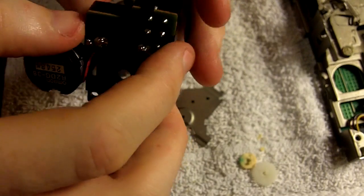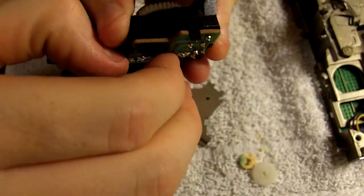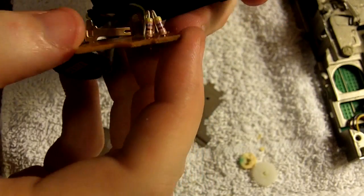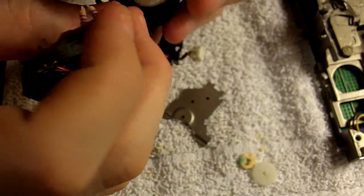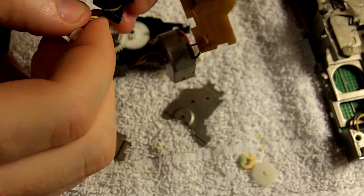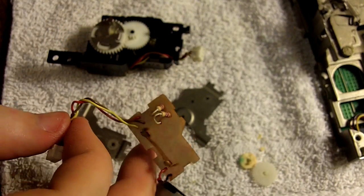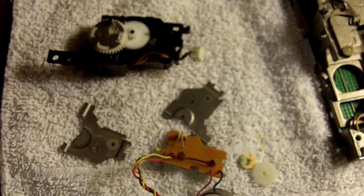But with some finagling, you can get the little drive to pop out of place. And then once that's actually out of place, we're going to move on to the circuit board there. Again, the little plastic tabs — be very careful with them — but if you kind of just gently push them aside, you can lift that little circuit board right out. And then finally, to remove this complete assembly of board, motor, and connector, we're going to unroute the little wires through the housing there, which isn't very difficult to do. And there you have it — there's the complete assembly of connector, motor, and board.